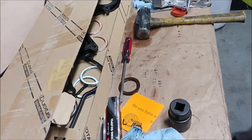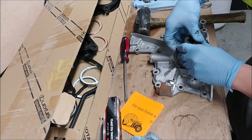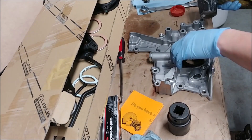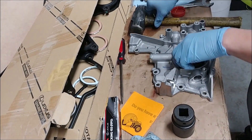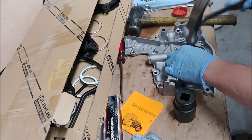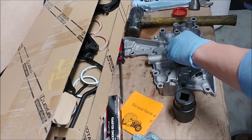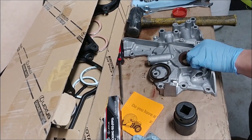What I'm doing here is prying off the old oil seal — going to use that for the installation of the new one. I tried with a socket and a mini sledge and that wasn't working, so I eventually just got a small hammer and tapped around the outside of the old oil seal to press the new one in, periodically checking the circumference to make sure it's fully flush and in as far as it can go.